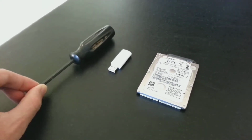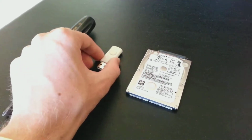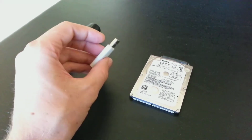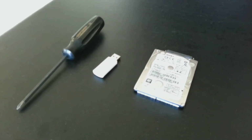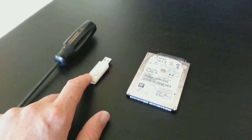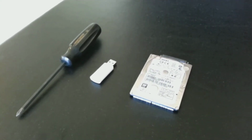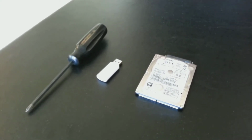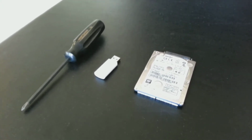Secondly, you'll want a Phillips head screwdriver. This is important for removing a screw inside the PlayStation. And finally, a USB thumb drive. Now on this you'll want to preload the latest firmware for your PlayStation. We're going to be replacing the hard drive, and so your PlayStation won't have anything to boot off of. So by loading the latest firmware onto a USB drive, you'll be able to format your new hard drive to the PlayStation format. You can download that software from the link that I've provided below in the description section, or by Googling PlayStation firmware. It should be the first result in your Google search.